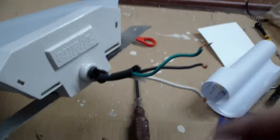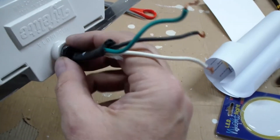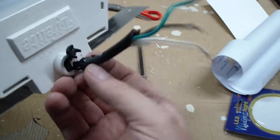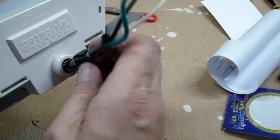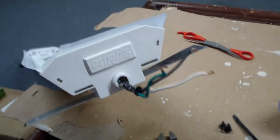Here's the key to getting this stupid piece of junk open. The cord is attached in here, so it won't open. You have to pry this keeper out and then take the cord out of the keeper. Then there are two slots — you pop that out, and there's another slot right there, you pop that out, and then this end cap will come off.